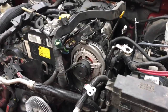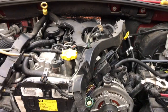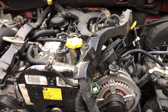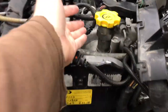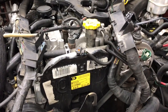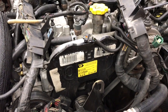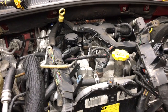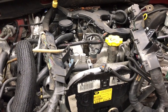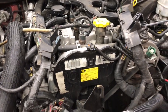So the nice thing about this is these kind of hard things of getting the wiring harnesses exactly in place and routed around by the transmission and everything, I get to do out on the floor and then shove everything in all together, with all these connections. I don't have to undo them and get all this stuff out of the way. There's a little bit of work because I got to undo the drive shafts and the cross member, but the kind of grunt work of trying to undo the transmission from underneath, I don't have to worry about. And like I said, there's some wiring harnesses that run around the transmission. I can get those back in place a little bit more easily.